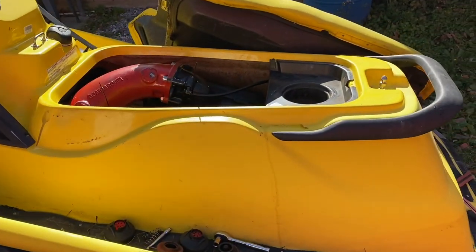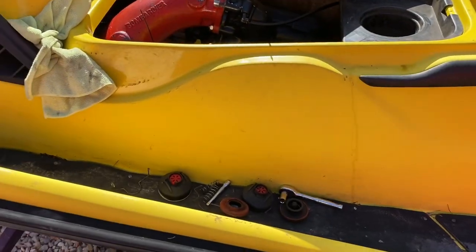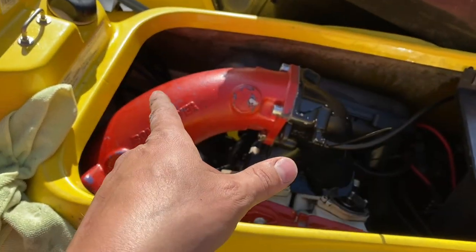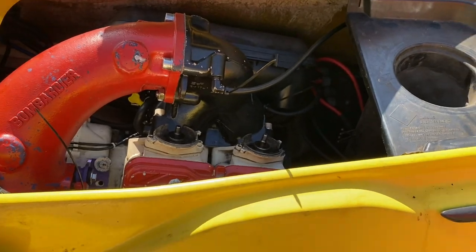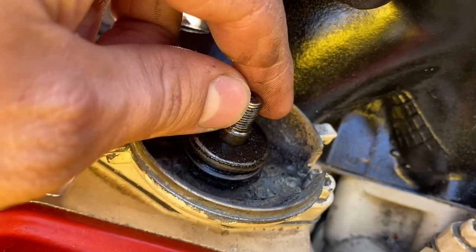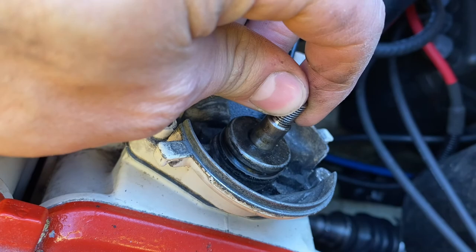Back again — I was going to test it out. I dipped it in the water yesterday and it would have good power up until about half throttle. Everybody's saying clean the carbs — carbs have been cleaned, fuel lines have been redone, got rid of the green goo in the selector. Worst case, I'll pull them back apart and check the fuel filters. I also need to pull the RAVE valves apart and see if they're functioning correctly.